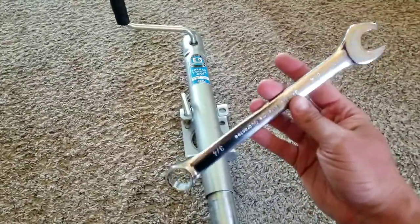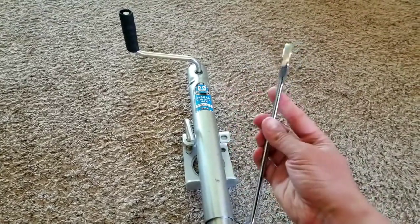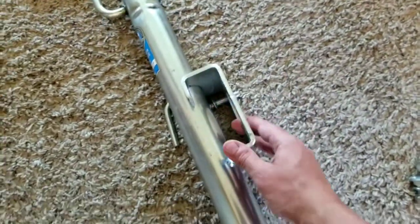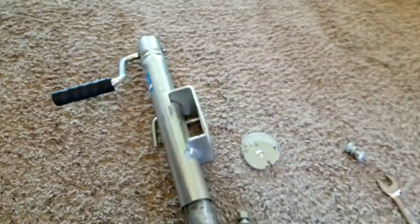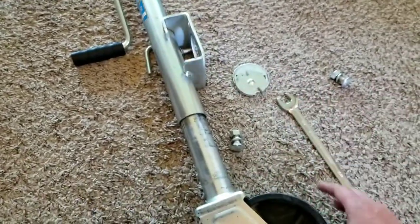It's actually really easy to take off the existing trailer tongue jack. All you are literally going to need is a three-quarters-inch crescent wrench — that's it. Usually they come pretty well sized like this, reasonably thin. There are only two little bolts that hold your tongue jack on. Behind this plate there's a little bracket, but basically all you need to know is there are two bolts. You just get up inside from underneath, loosen them, and pull the nuts right off. It took me 30 seconds. You don't need to remove the bow stand or anything like that.